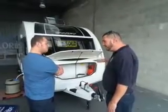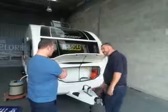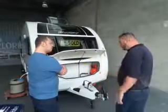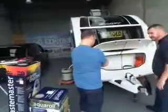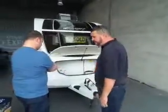If you can't, you can reverse it up, but you may find that the brake will push in when this pushes on. So you may struggle a bit to push it on, but just see how you get on. But once you've got it level left to right under the wheels, front to back's all done off the jockey wheel on the front. The jockey wheel just winds up and down, as easy as that. But I'll talk more about that, because I'll hook it onto the car at the end anyway.